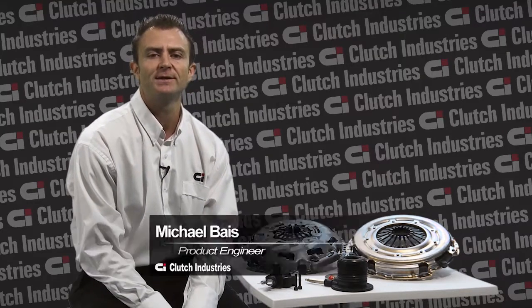Today I'll be talking about technical bulletin number 4. This relates to Holden Commodore and Calais VX. This has a 5.7 litre engine, V8, and it runs from 2001 to 2002. This technical bulletin talks about the need for a spacer between the concentric slave cylinder and the transmission.